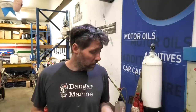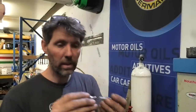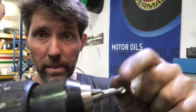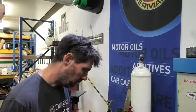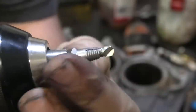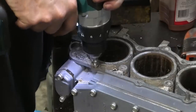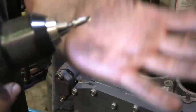What I'll do now is try one of the other bolts and use some of the other easy-out kits. Let's try the other type of easy-out that has the combined drill bit and extractor. I'm looking for the largest one that will fit inside the bolt — I think this is about the right size. Once it's in the chuck you wind the extractor right hard against the chuck so you've got as much of the drill bit exposed. Then center punch again. We have to set the drill in reverse because this is a reverse-thread drill bit. Now we've got the hole drilled — wind the extractor part down to the tip and use it in the drill again. There we go — not the tightest bolt in the world but it worked pretty well.